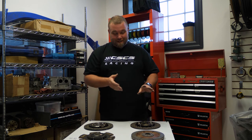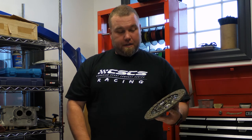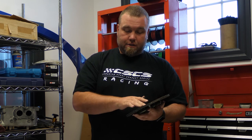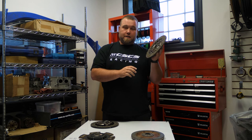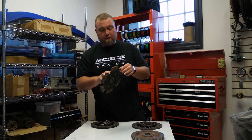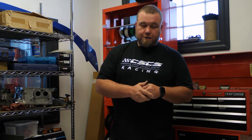In closing: for a street car that's fairly stock — downpipe and access port — stick with the stock clutch, it works really well and lasts the longest. Up to about 400 to 450 horsepower, the metal-and-organic sprung stage two clutch is probably our number one seller. Once you've decided your car is a track-only vehicle, then you can look into multi-puck and unsprung units. Thanks for watching — check out the link above to learn about Subaru head gaskets and how they fail and how to fix them.